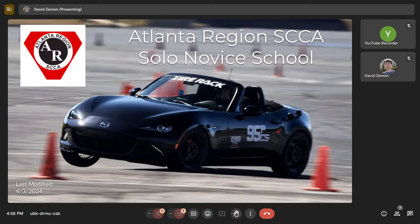So, on tire wear, are there good camber angles? Autocross is harder than road racing because a lot of people are going to be driving on the streets. I used to run a ton of toe on the S2000 and I just ate through tires on the street, like 5,000 miles on some of these tires. So you obviously need to take into account what you're using the car for, but in general, however much camber you can get for the class is what you want. That's either going to be in a completely stock car where you're just maxing it out, or in a modified car where you can play around with the different things.